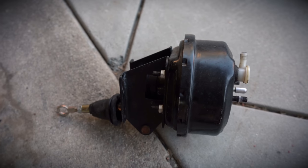Another reason I wanted to switch to manual brakes is just for better feel. I've heard so much about manual brakes, and the problem with power brakes is inconsistent braking — you're relying on another system. Anyway, before we start, please subscribe, like, and share the video. Let's pull the Mustang into the backyard.